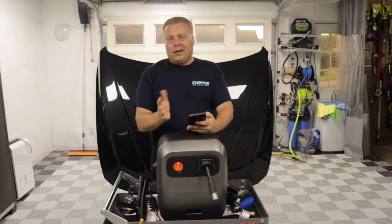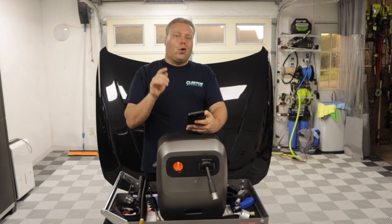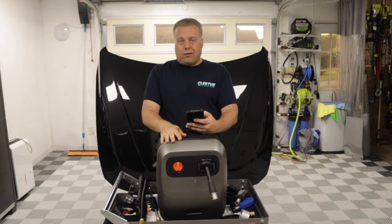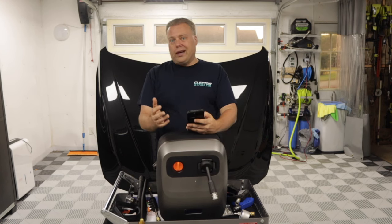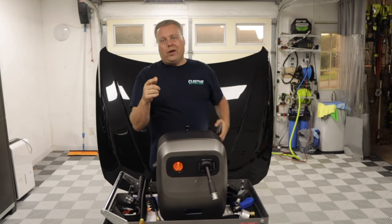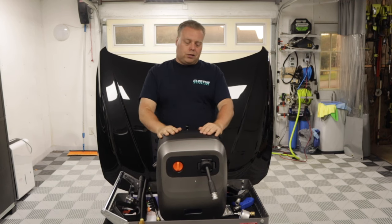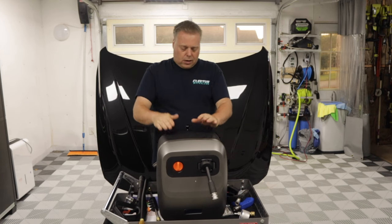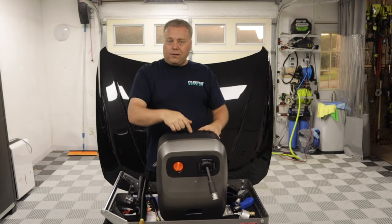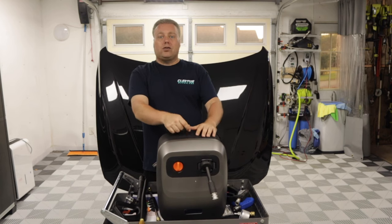If you hook the garden hose up and let it run straight, the rated flow is 1.4 GPM and rated pressure is 2075 PSI. Weight is about 35 to 40 pounds, much lighter than the other ones. It's a cold water only unit — 104 degrees Fahrenheit max — so nothing from the hot water heater. It's rated 1800 watts, which is 15 amps. For 15 amps, if you're under 50 feet you can run a 14-gauge wire; over 50 feet you need to go to 12-gauge.